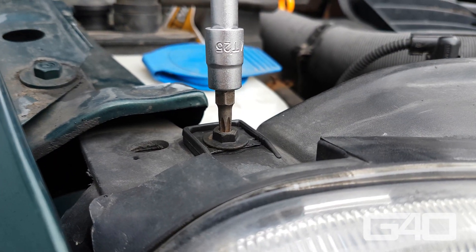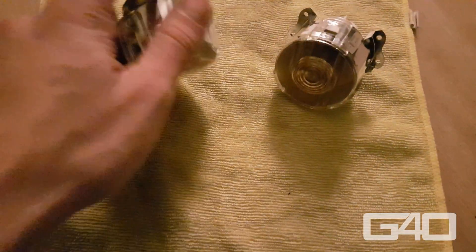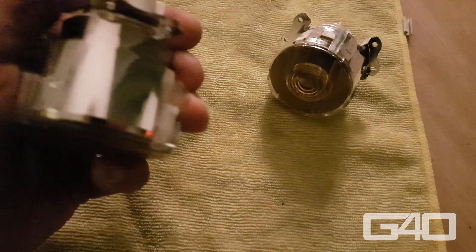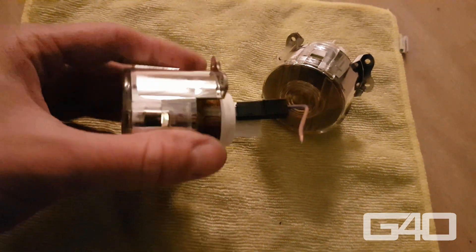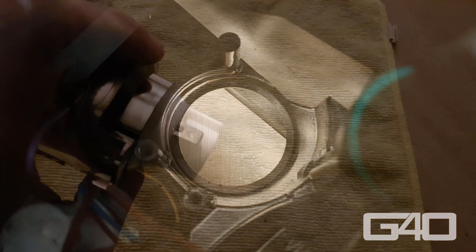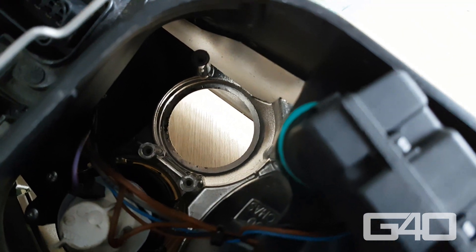After reinstalling, make sure your lights are adjusted correctly. For this build you need two indicator housings by Valeo — you need those even if you have Hella headlights. You need to remove the chrome plastic part below your indicator. After doing this you have to glue those new housings in, and you also have to wire those two contacts to your first indicator bulb socket.